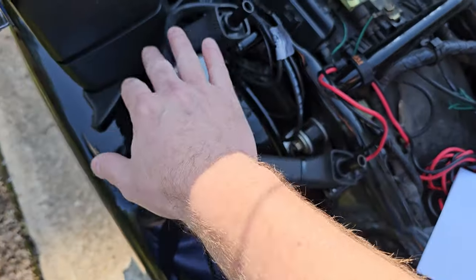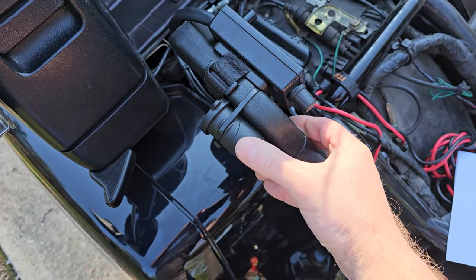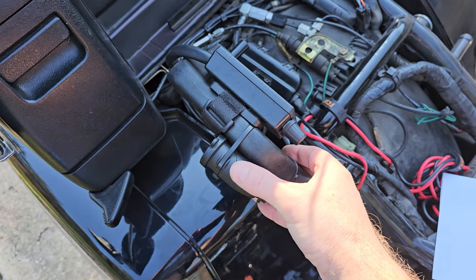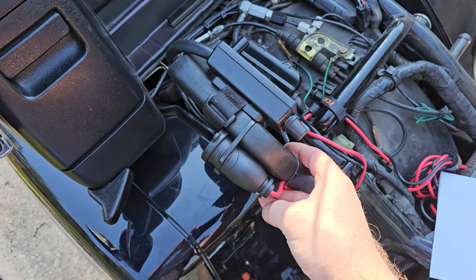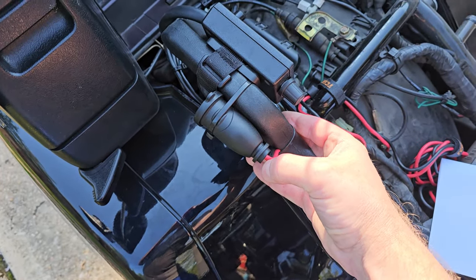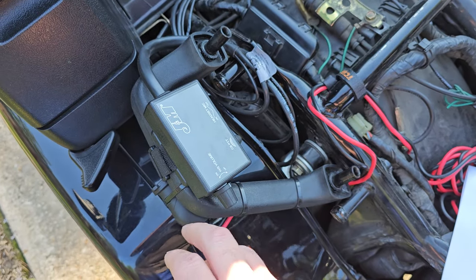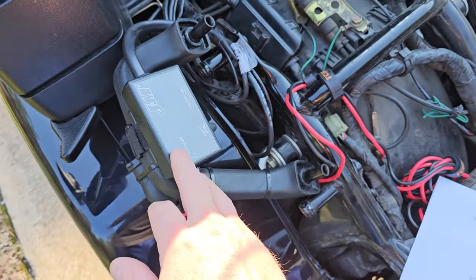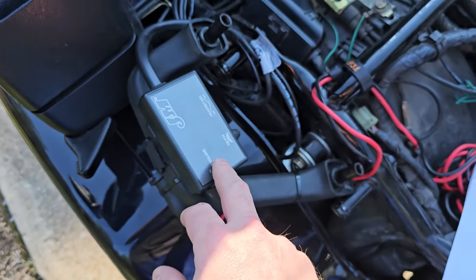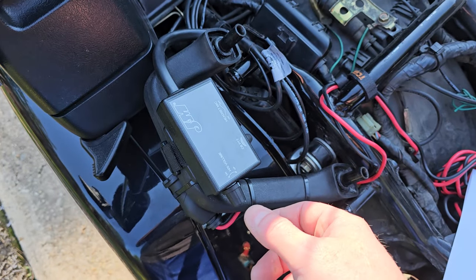Another thing I did is I got my handle off. The reason I can't pull the handle away when I take it off is because I have a 12-volt outlet right here - a heavy duty one - because my girlfriend gets cold real quick, so she can plug in an electric blanket. It's got heavy gauge wire because anything electric like that for heat draws a lot of current. I also have this J&M module for the passenger headset. I found it brand new on the internet at a cycle shop for $99 because J&M doesn't make this anymore. It's an inline plug-and-play for the passenger headset.